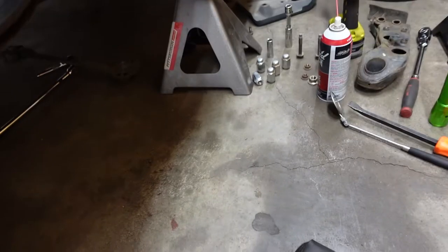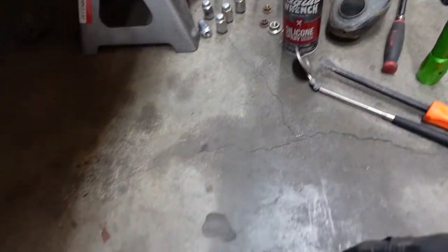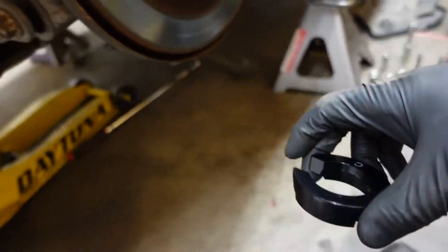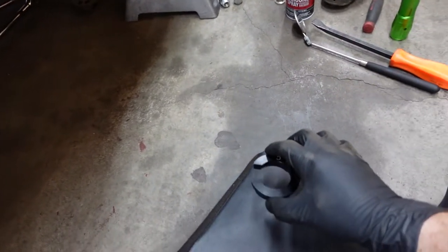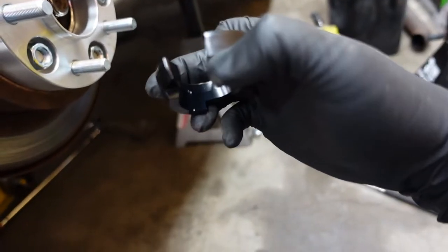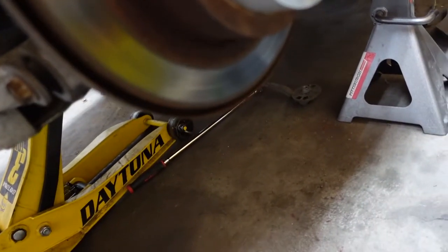I just put the opening toward the inside for the front collar as well. I've been trying to press them down — it's been kind of difficult. I even used silicone spray to make it easier, but after pressing it down all the way it just pushes itself back up. Make sure that when you have this in here and twist it, you can feel when these little pieces kind of snap down into the opening where they want to rest. If yours isn't staying, make sure it's oriented correctly. Press it down enough so that when we put the subframe back up, it presses into the correct position. If it's not in position, the subframe pressing on the bushing could cause the bushing to tear.